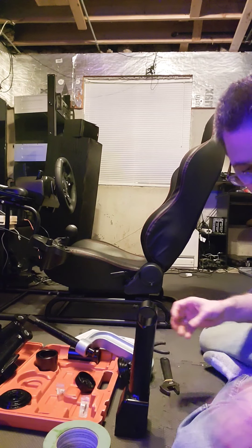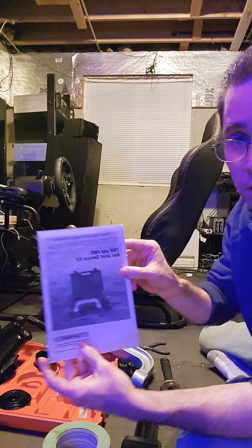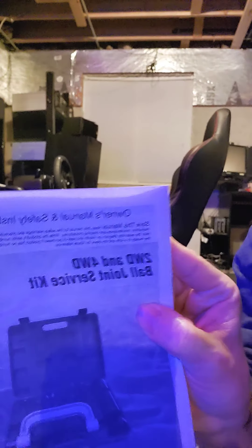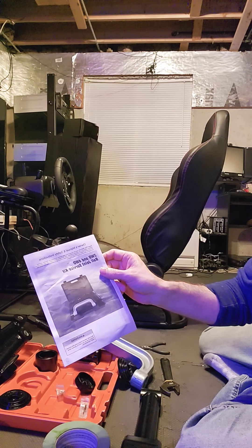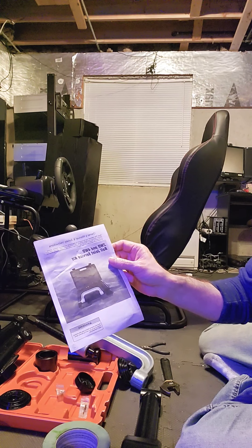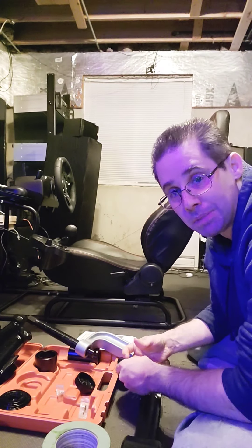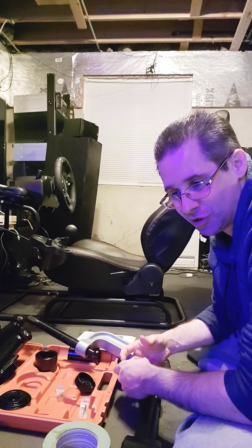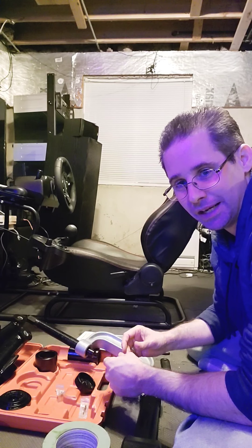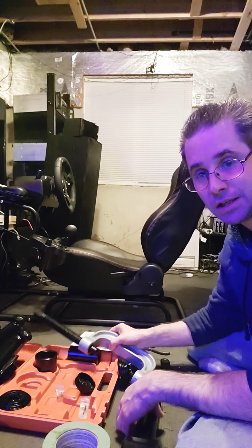To press these together I'm using a two-in-four wheel drive ball joint service kit. You can find it on Amazon for around $42 and it works quite well for pressing this together. I know that some people will use a hammer — I think that's the recommended instructions — but please don't do that. You might actually damage the components.